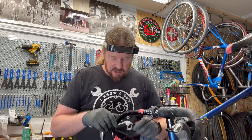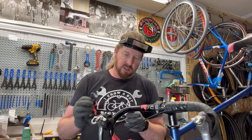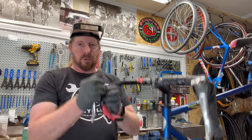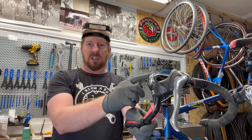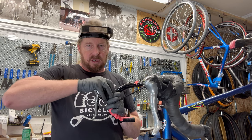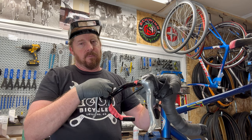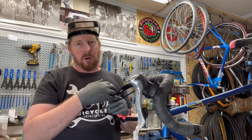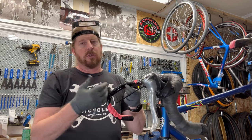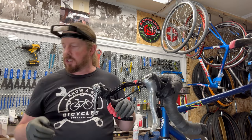I like wearing gloves on this, but sometimes you get some really old, gunky, sticky stuff, which is horrible. So you get that bar exposed. Look at this bar — it has an indentation here and also an indentation on the back. The reason being is even back then, Campagnolo had housing that came out for the shifter. Newer ones have shifter cables and housing — that's where that housing would lie on both sides to give you a more round feel.